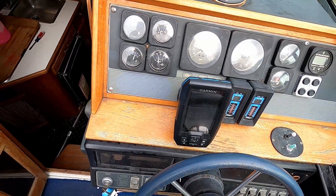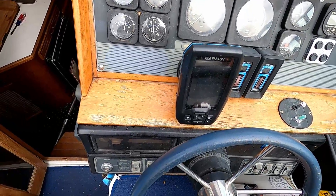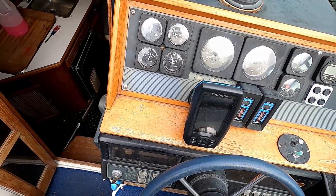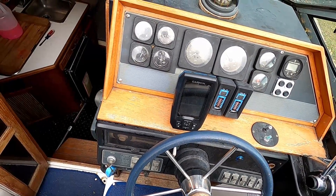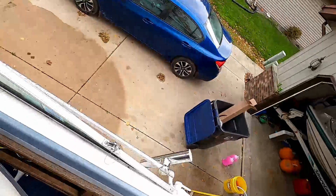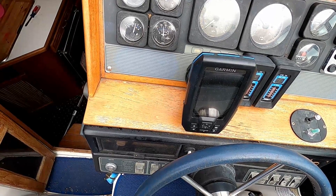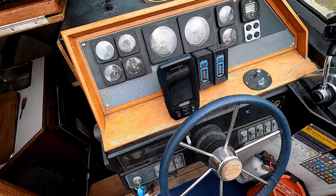Temperature still holding at 150, doing the needle opening and closing thing. Checking the bucket — we're pumping. Looks like we're good there, bucket still pumping. Oil gauge is jumping around, but look — temperature dropped down, it's tanking. Now it's going right back up — thermostat's opening and closing. Watch that stat needle, we're back down to 150 and falling. It'll climb back up, and as soon as it does I'm going to jump down and add my bucket.